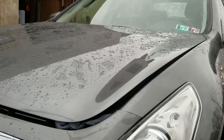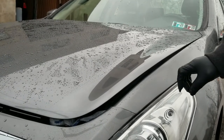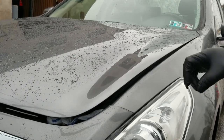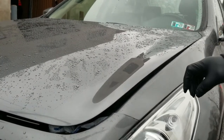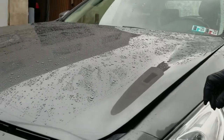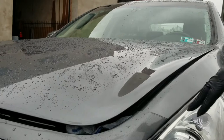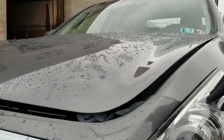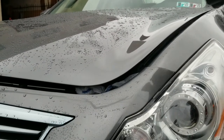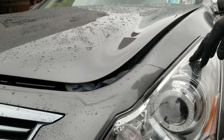I replaced it. The wire — the connector that comes off the ballast and goes to the bulb itself — was a little bit shorter than the original one, but I wanted to use the one that came with the ballast. So it took a little finagling to get it on, because that ballast area was very rusted out pretty badly. I didn't want to take a chance and go through all that work to put it in and find out I had to replace it again.